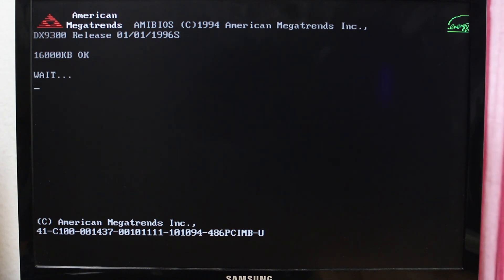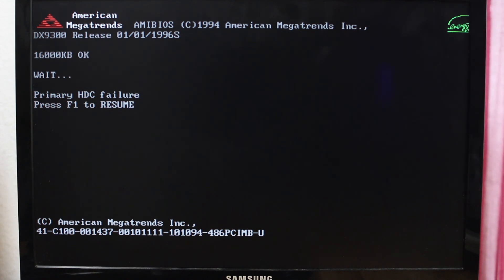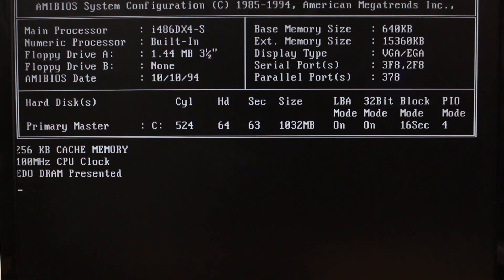I've tried this drive on quite a few systems and very few detect it correctly — I've no idea why. The other thing I noticed when I booted earlier is that it said the cache was 256k, which shouldn't be the case. And there we go: hard drive controller failure. So I'll set that up according to the numbers actually on the drive itself. Once done, it detects the CPU correctly and even the EDO RAM, but unfortunately it's still only showing 256k of cache, and moreover it just completely hangs — so it looks like it really doesn't support 512k of cache.